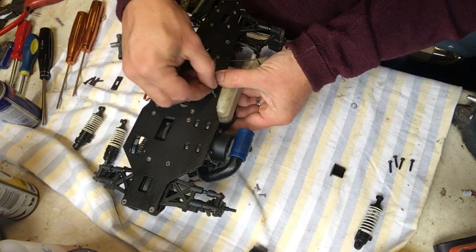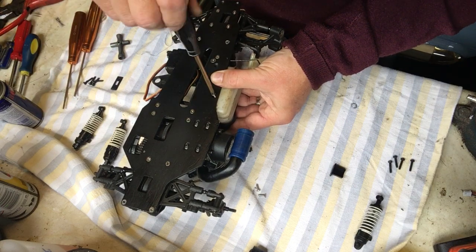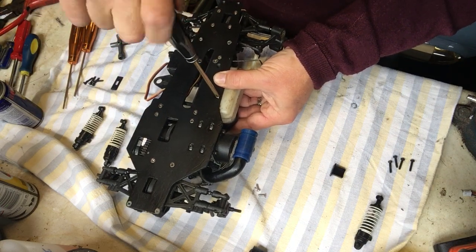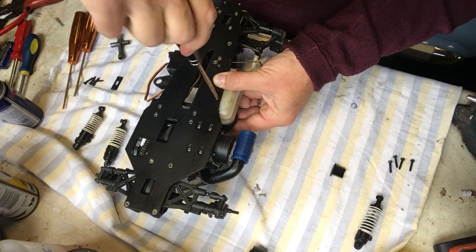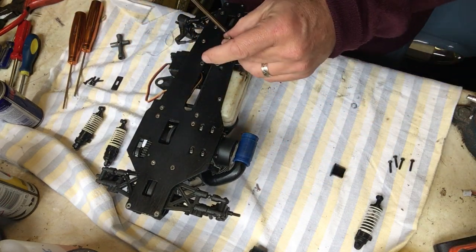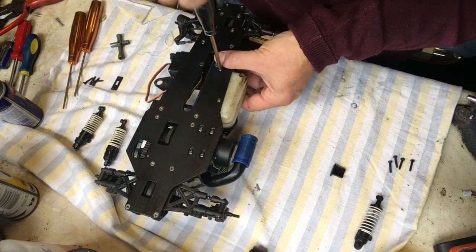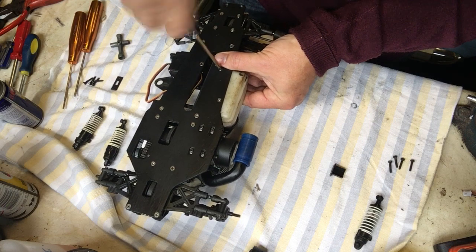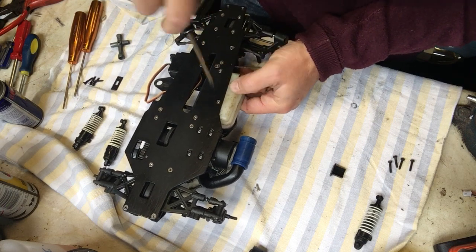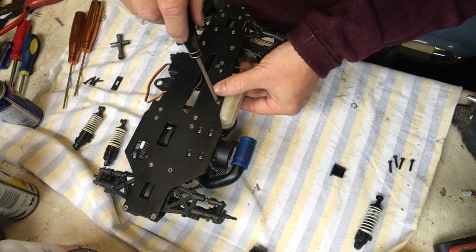So in fact I've got 3 screws out for this. In this case I only need 2 because this tank only has 2. Some of the TS4Ns have a little plate just over the tank here to protect it, like a black plate. This particular one doesn't have one. The later ones have one. So if you have a plate, then by all means put it in place. It will certainly help to protect the tank. In reality it's going to take quite a bump to go through there, but if you want the protection, there's no harm in putting it in place.